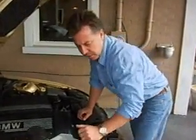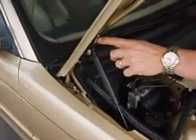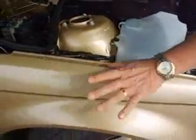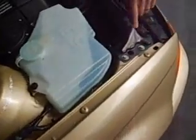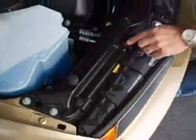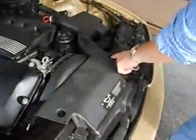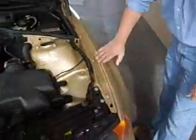Another thing I do is look down the body lines here, see if you see any chips right here where the hood's been off, where it's been painted. A lot of times you can feel right here the body lines where any paint marks are where it's been painted. This car hasn't been painted. Look down these bolts right here, see how these haven't been taken off. These aren't worn. Look for all your plastic grommets. Make sure all your push pins are in down through here. Then again, check your other side.